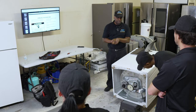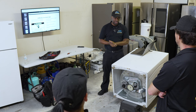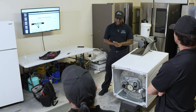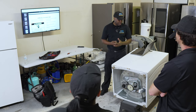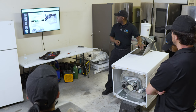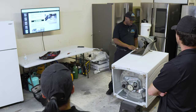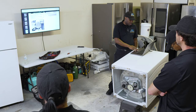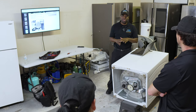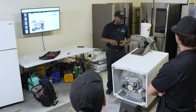Symptoms of a bad drain pump: water won't drain. The customer tells you they're washing clothes, the water just sits there and stops, or they hit cancel, hear something vibrating, but no water is leaving — that's potentially a bad drain pump. You can see the seal inside the head of the drain pump that seals it after you screw it down. To replace it, remove a couple of screws, a hose clamp, and the pump drops out. Key thing: bring a shop vac to get all the water out. Don't show up to a drain pump job without a wet vac. Have towels to protect the customer's floor.